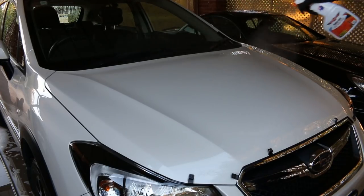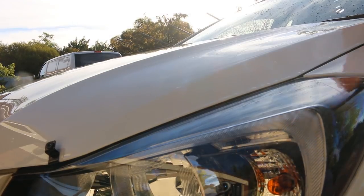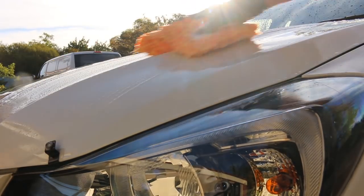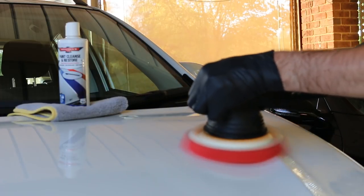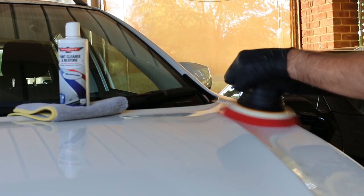The car was left feeling slick and looking clean, and just to double check how well it removes iron fallout, I sprayed it over where it had already been to see if there was any reaction. Great to see that there was actually no reaction at all, which tells me it did a fantastic job of removing that grotty unwanted mess. Once I was done using 3-Way and the claying rubber, I gave the car another quick suds down to avoid leaving any of the product on the surface. Even though it's relatively safe compared to other chemical decon products, I still wanted it all gone. I wanted to make the most of the car being completely stripped, so the next day after washing it yet again, I gave it a once-over with Bowden's Own Paint Cleanse and Restore — not a correction product; what it does is literally in its name. This was another recommended product to use to get the most out of your protectants that you choose to layer on.